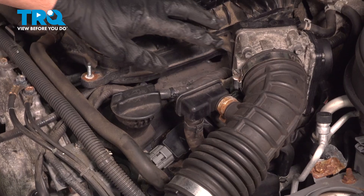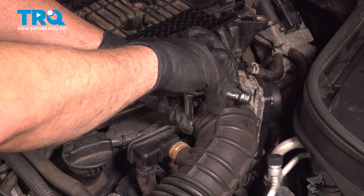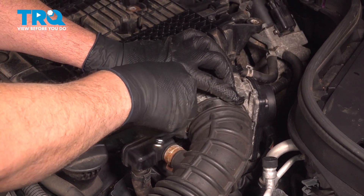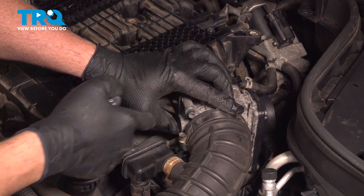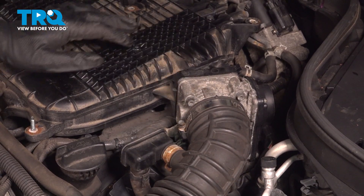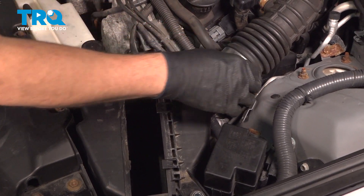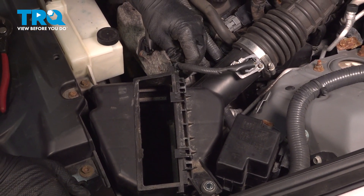Use your pliers to bring this hose clamp up into position. Up on top at the throttle body, secure the clamp. When tightening this, you'll feel that hose clamp snug down — just give it a little bit more. Don't over-tighten it as you can strip the clamp. Make sure it's good and snug so you won't introduce any vacuum leaks to the throttle body. Go ahead and install the harness down to the sensor — press that on, you're going to feel it and hear it snap into place. Install the harness retainer on the side.